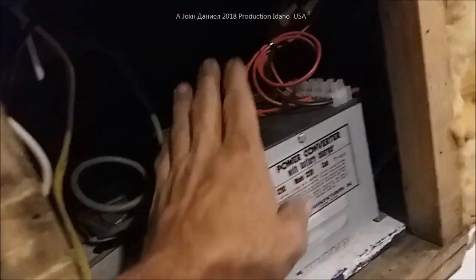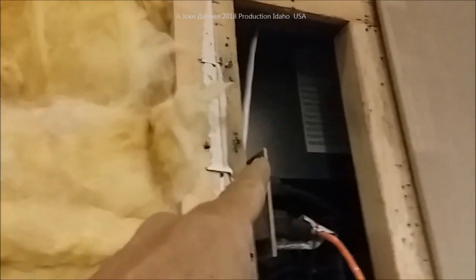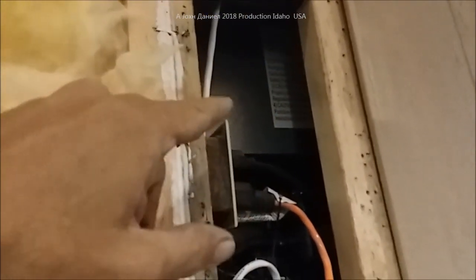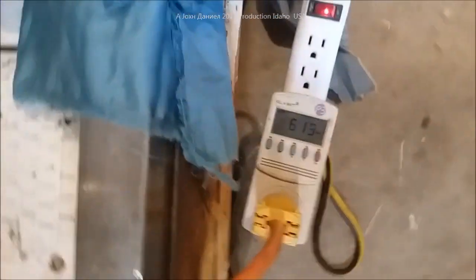This will not be pulling nearly 100 watts to power the lights - that's out of the equation, that's five, six, or seven amps - the batteries will handle all DC loads. The refrigerator back here is being replaced with an electric one at 58 watts of running power. The one that was in it quit after a week - the big one pulled 195 watts on electric with no benefit. We'd rather use the solar to go electric and we're now putting out 620 watts.